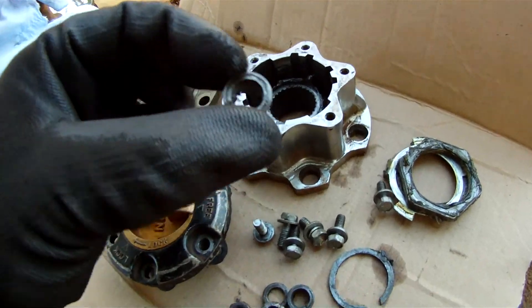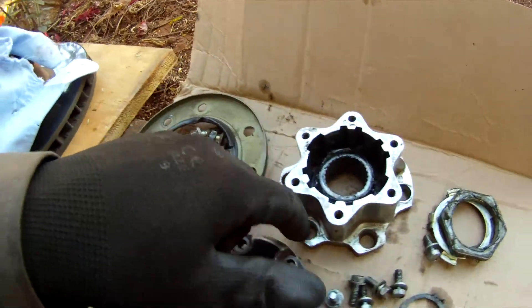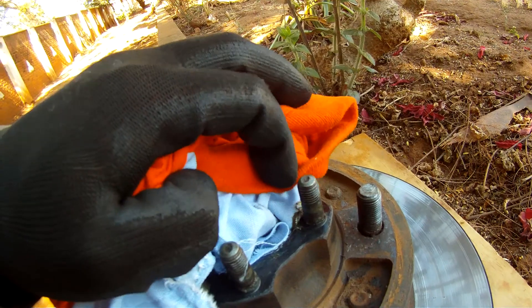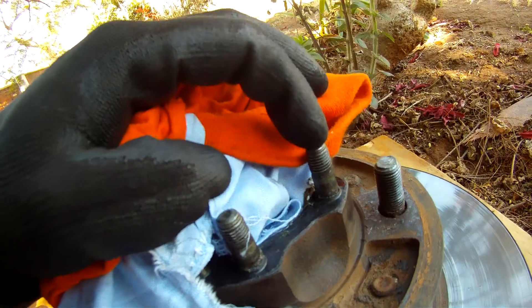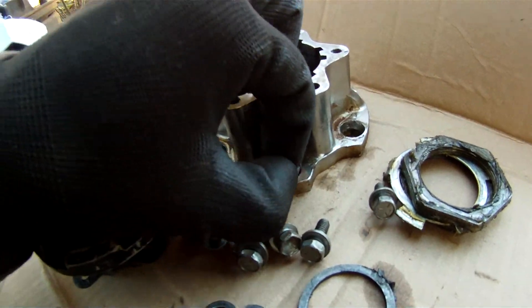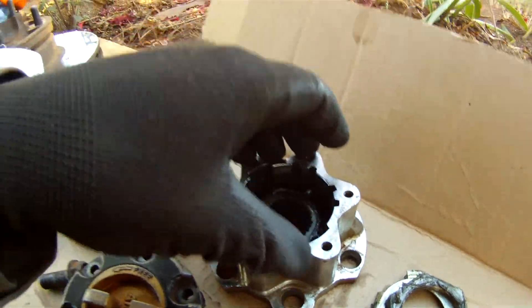One of the main differences is this is held on with cone washers through the studs. So instead of it being drilled on here with bolts through, these have got the studs in here. I think I probably prefer it the other way around like Land Rover, because studs tend to get damaged quite easily, and if you strip the threads or what have you, it's a lot more tricky to deal with. But anyway, they have this cone washer that fits over those bolts with a spring washer and a nut. These are a bit fiddly to get out, so you can't get this off as easily as the Land Rover.